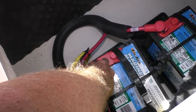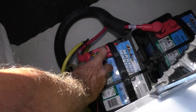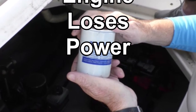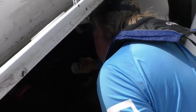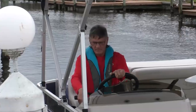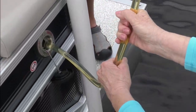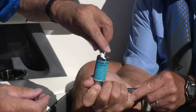Look for corrosion at the battery terminals and the engine end of the wires. Clean with a wire brush and treat with anti-corrosion spray. If your engine is sputtering and losing power, check for a filter problem or fouled plugs. Replace the inline fuel filter, or at least remove any debris from the filter element and drain any accumulated water. Ventilate the engine compartment thoroughly before restarting. Leaving a fuel tank near empty for long periods can cause condensation and water in the gas. For long-term storage, fill the tank and consider a fuel stabilizer.